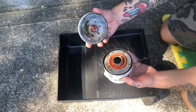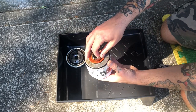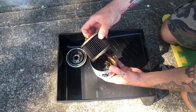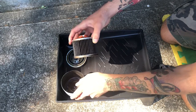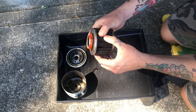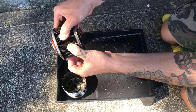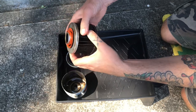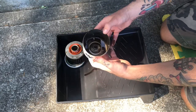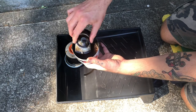Top comes off. You can see the drip holes, how it attaches to the motor, a little rubber seal, and then you can pull the actual filter itself out. You can see it's a lot like an air filter. A lot of guys will even cut these apart and go right inside and peel them apart and look for debris inside here as well. You can see inside there there's debris as well. A lot of guys peel these things right apart or even cut them really deep to find stuff, but everything I needed to see was right in the bottom. Here's that extra little feature - it's an extra little catch. You can already see bearing debris all over this thing.